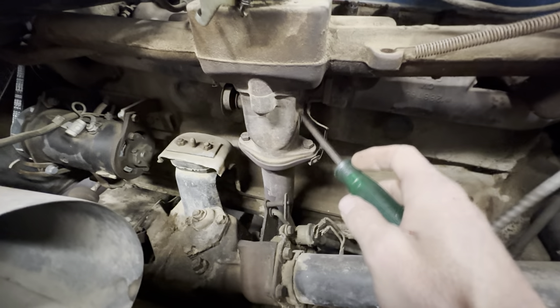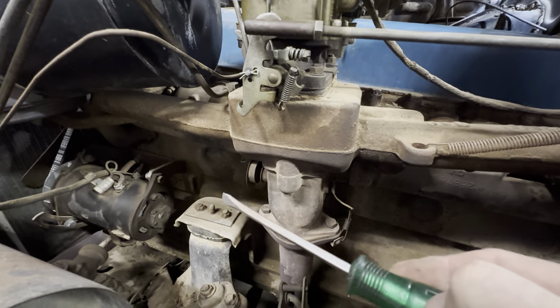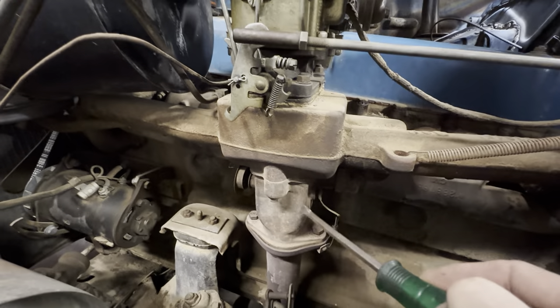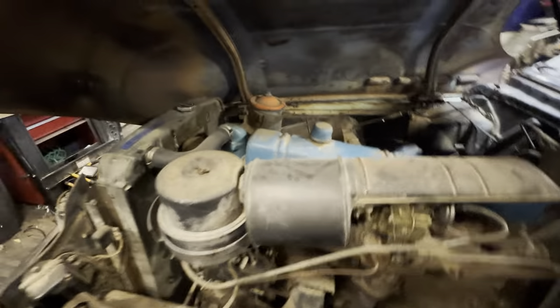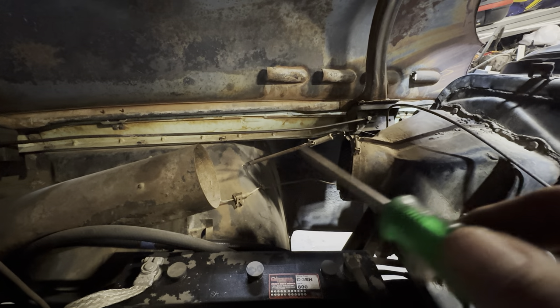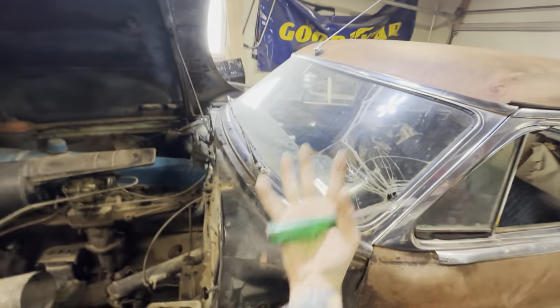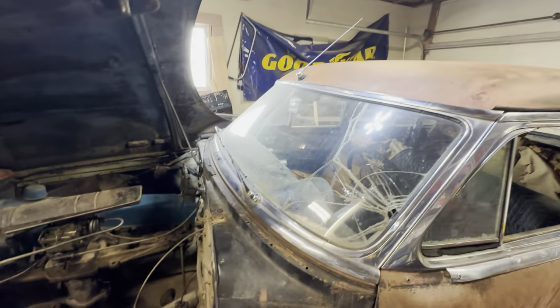A lot of stuff to do here. This valve is set to open with temperature so that hot exhaust gas blows on the bottom of the carburetor when you start up in cold weather, heating it up quickly so it runs efficiently and idles in the cold. Then as it warms up — just like the choke — this will close. They tend to stick open or closed. The heater has ducting that blows into a heater coil for the defrost, plus hoses going down to a blower and heater core under the front seat that blows hot air onto the passengers' feet front and rear.